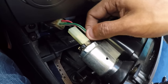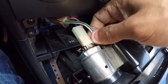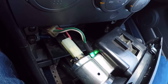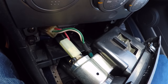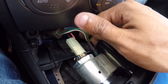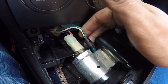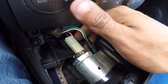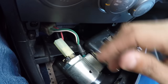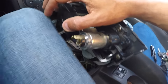I'm going to have three connections. The first one here is for the illumination light — it's just a quarter turn to the right and that pops out. Now before I do anything else, I'm going to take the keys out of my ignition and put them on my passenger seat so that I don't have any power going through this. It is advisable to completely disconnect your battery, but for something like this — a circuit that isn't going to have any power anyway, at least on my car — I don't really see the need to disconnect the battery. Next, I'm going to pop off these plugs that go to the back of the lighter.